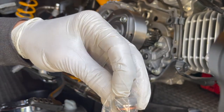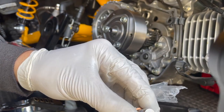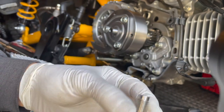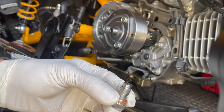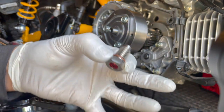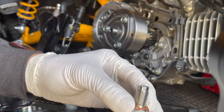So the Mag Plug has a magnet inside. Most of these types of plugs have the magnet epoxied on top, and I don't like that — these things are made in China and I don't know how good that epoxy is. My concern is the magnet could come off, get into the engine, and since magnets are very brittle they'll shatter into little pieces. Because it's magnetic it'll stick to the gears and keep crunching in there and just mess things up.